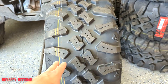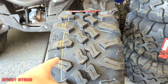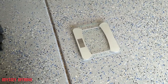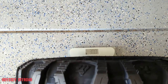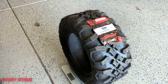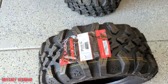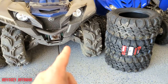These aren't mounted or inflated so it won't be a true test, but we'll see what they measure up once mounted tomorrow. We'll compare measurements on and off the rim, similar to the weights. All right — got the scale out here in the garage. One tire comes in at 30 pounds on the button. So if rumor has it the Zillas are 23 pounds, you're picking up about 7 pounds of tire — though we'll verify that once they're unmounted tomorrow.